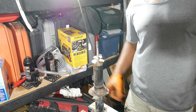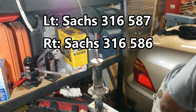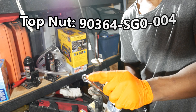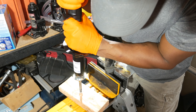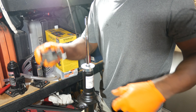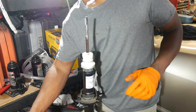At this point I can remove the 14 millimeter top nut. An impact wrench will work fine on OEM struts, but I like to use a 5 millimeter hex wrench and a 14 millimeter ratcheting wrench to take it nice and slow, just in case the spring isn't adequately compressed. I stopped to make sure a gap was forming between the top mount and the nut as I removed it. The compressor rod on the right got pretty close to the top mount so I had to adjust it a little to remove the top mount.